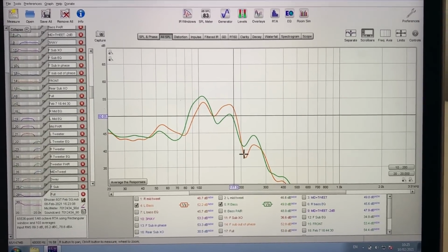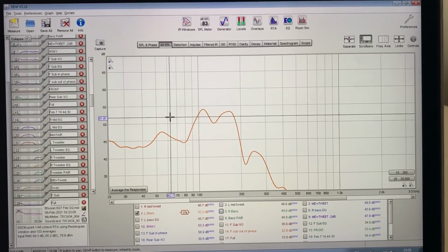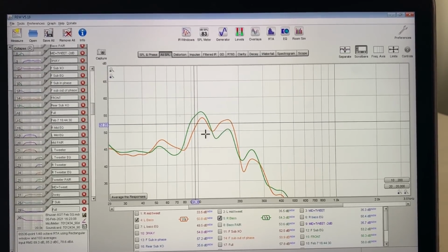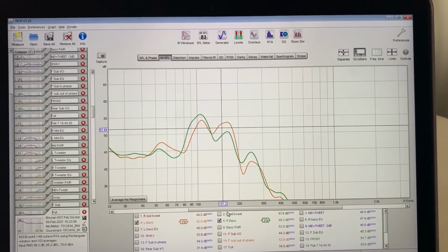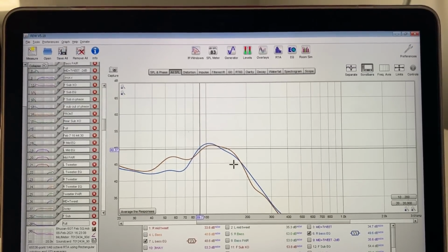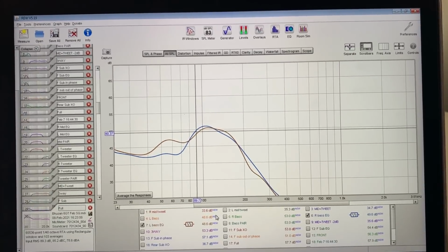So mid bass. We had the left mid bass, the passenger side in our case, because it's in the UK. As I crossed it higher now, it didn't have to play low where we had that problem between 60 and 90. It was crossed at 80. And yes, we had a dip on both sides, even in that range between like 120 and 150. But after the EQ job, I ended up getting this. Yes, I had to drop those peaks and get something more even, which is more functional for getting a decent tune, and then readjust the gains to get enough level for the mid and tweet pair.